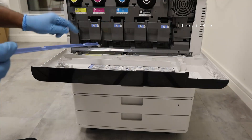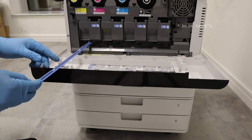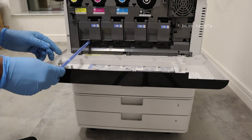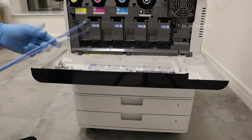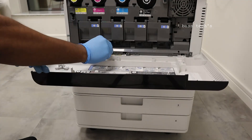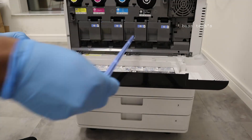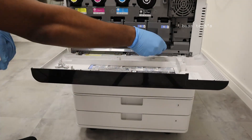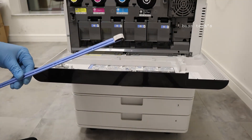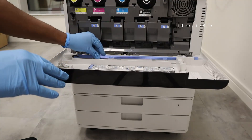You can push and pull the cleaning rod along the rail so that the laser exposure area — the laser output area — will be cleaned properly. This is something mandatory which you'll have to perform in every preventive maintenance. That's all regarding the laser assembly.